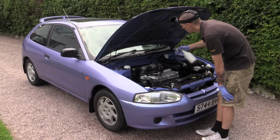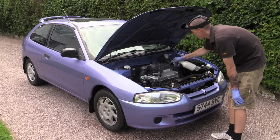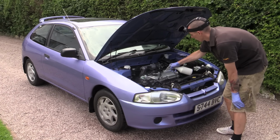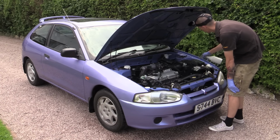The best way to dress an engine is when it's still wet, so after rinsing I liberally sprayed all surfaces with Autosmart Finish, a water-based cleaner dressing, but a product like 303 Aerospace Protectant or Meguiar's Hyper Dressing would also be perfect for this.